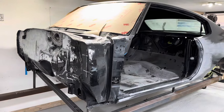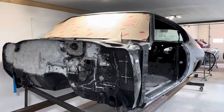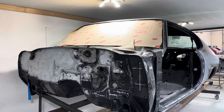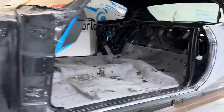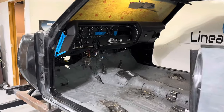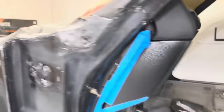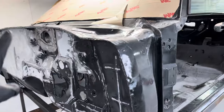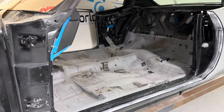Over here we've got a 70 Chevelle we've been working on. This project has escalated a lot since it came in. It came in for a paint job — we were going to just paint the outside, paint the jams — because none of the panels fit the car. The doors didn't fit, the fender gaps were terrible, the hood was a mile high in the back. And that has all escalated. We're going to be pulling the dash out, and we just got the vintage air mocked up on the back side of the dash and welded all the holes shut. Now we're going to start filler work on the firewall next week.